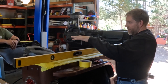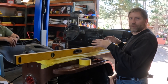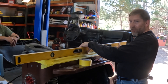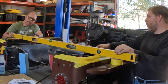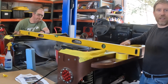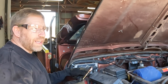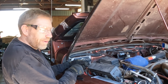Genrite recommends getting the body level so that you can use that as a reference for squaring and truing the cage. In this case we're coming up a little bit low at the front — probably need to come up one click on our jack stands on the front end. We're also coming up a little bit low on that side, so again maybe one click on the jack stand on that side to bring everything up to level and square. To protect the vehicle electronics, before you start welding on things attached to the vehicle, always remember to disconnect your battery cables.